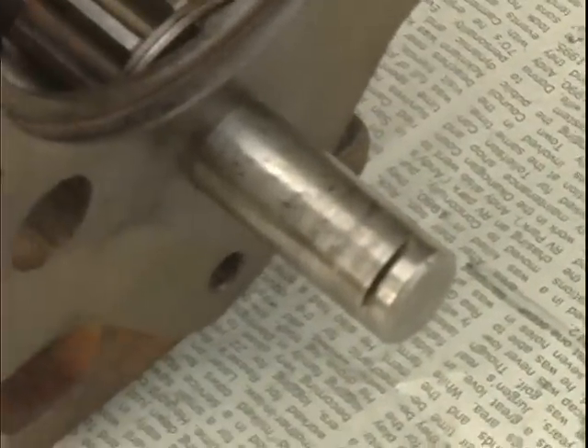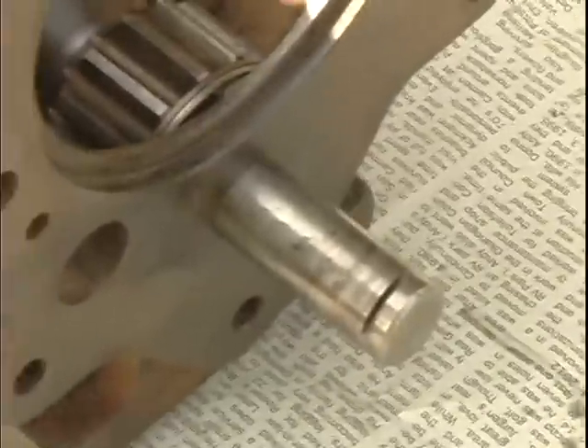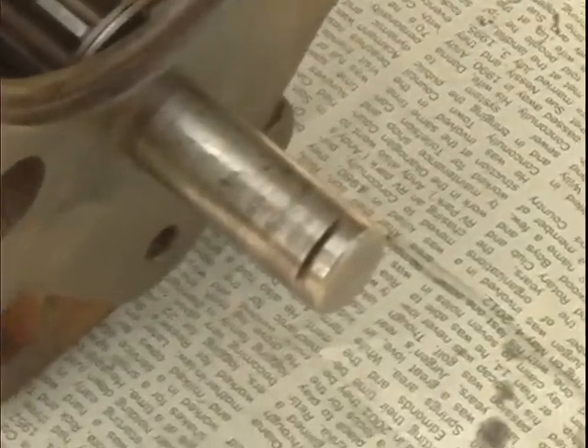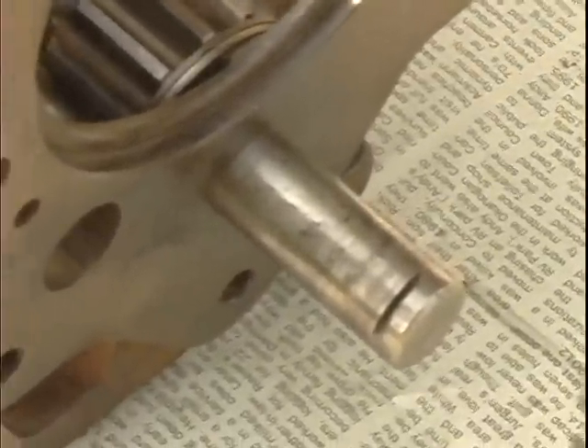I should add two more things here. The actual spindle that goes in through here goes in that direction, and there's a notch that lines up with the reverse idler gear — and that's the pin that holds it in there. It goes in one direction; it's slightly thicker on this side than the other, so you always have to go in towards the front of the transmission. Remember that — it's a gotcha — because if you do it the other way, you'll tend to make that hole too big and you'll have oil leaks.